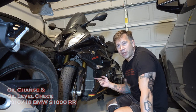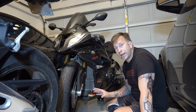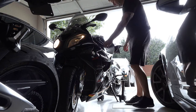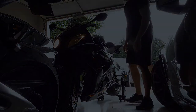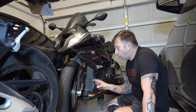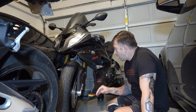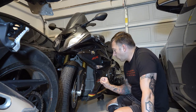This is how to change the oil on a BMW S1000RR or similar machine. Before I start the process, I want to run the bike a little bit just to get the oil inside warm. You'll notice I had the rear wheel moving and the transmission engaged as well — this helps get all the oil in the drivetrain and engine warm enough that it will easily drain everything out. I took it up to about 115, not all the way to operating temperature of 160-170. I just want it warm enough to drain easily, not hot enough to boil my hand.